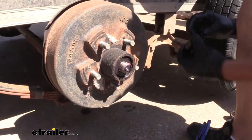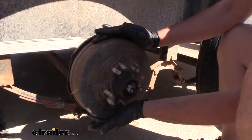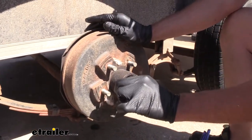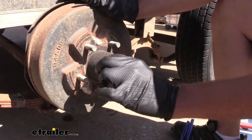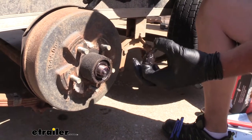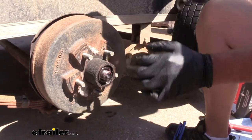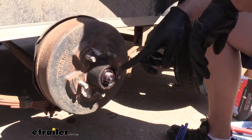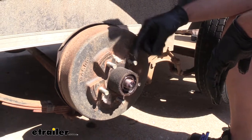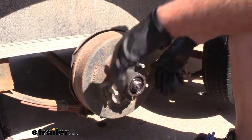These aren't very tight generally, so just a pair of pliers and those will come off. Then we're going to wiggle our drum just a little bit, and right here on the end we're going to have this thrust washer — we're going to get that off. Now if you're getting a new hub, like what we're going to be doing — we're going with the galvanized hub just to eliminate a lot of this rusting issue — then you won't need to keep your bearings, hub, or seal. If you're just going to be replacing the brake assembly, hang on to these things so you can put them back together.